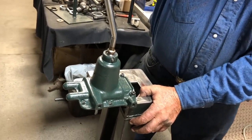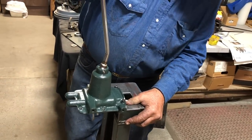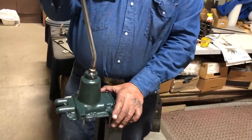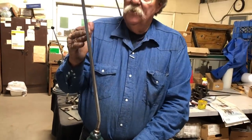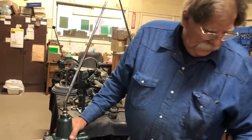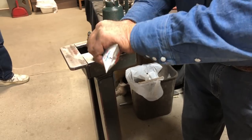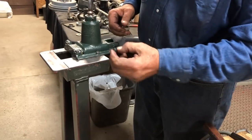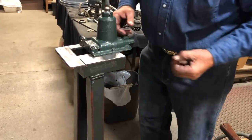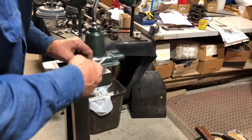At this point we've successfully changed the detents — nice and snappy in our tower. We take it and turn it over to show you how snappy it can be. We simply want to shift the tower to make sure it shifts easily in each gear. For a test, second gear is the most common — we go into second, come out, start it, tap it, and we'll see the actual detent take over to hold it into gear. There's also a little plug that fills the outside detent hole — give it a little bit of grease. That plug keeps dirt and grease out of the tower, and you had to remove it before you worked on the tower.